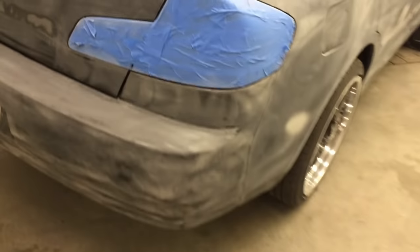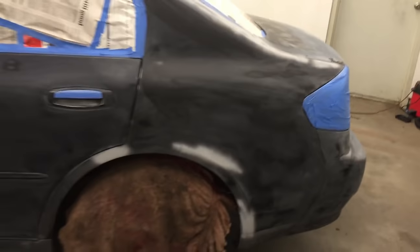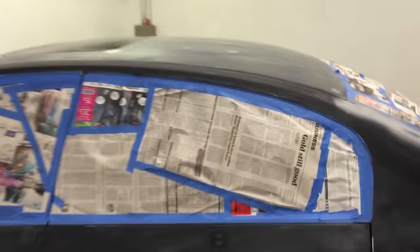One eternity later. All right, so you can see I got all the areas that had chip sanded. You want to make sure to get them pretty good. I primed some spots that had exposed metal, so now the paint won't chip. Now that it's all prepped after 2.5 hours worth of sanding and taping and metal spot filling, I'm gonna try to hit the roof, hood, and trunk tonight, but if not, it'll be in the next video.